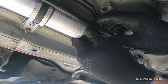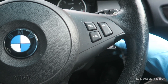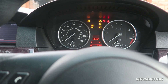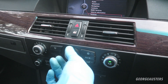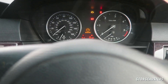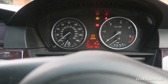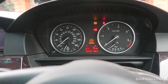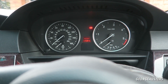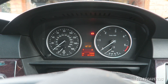The clip is back on and we should be all set. Now comes the hard part of trying to get the thing started. Let's put the ignition on and turn the heaters off. What we're going to do now is prime the fuel pump — I'm just going to cycle on and off with the ignition, because we need to get that fuel filter filled.